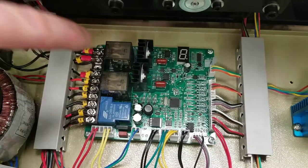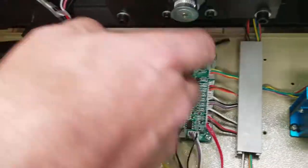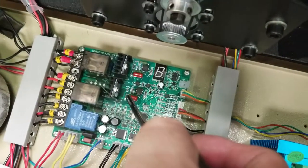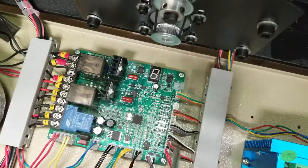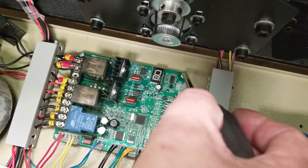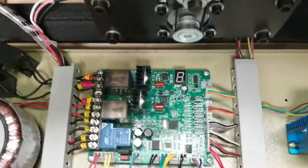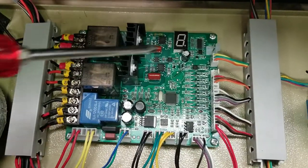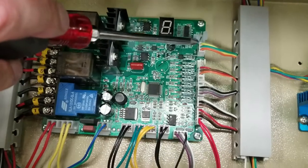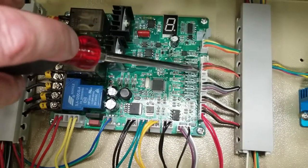I got the board back in. As you can see, they're all plugged in — got the screws all in on all four corners. When you're putting the spacers in, the plastic spacers — just be careful not to let them roll under the board, then it's kind of a pain. You may have to take the board off to get to them. Keep them standing straight up and very slowly move them over the hole. Just check the numbers on the sides of these plugs and match them up with the number on the board next to the plug.